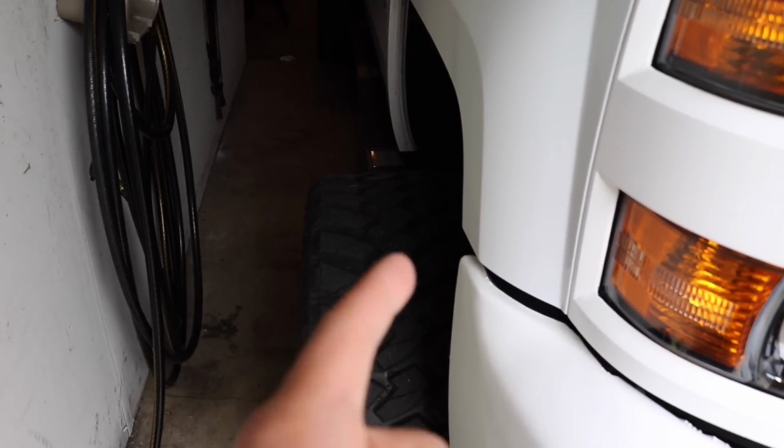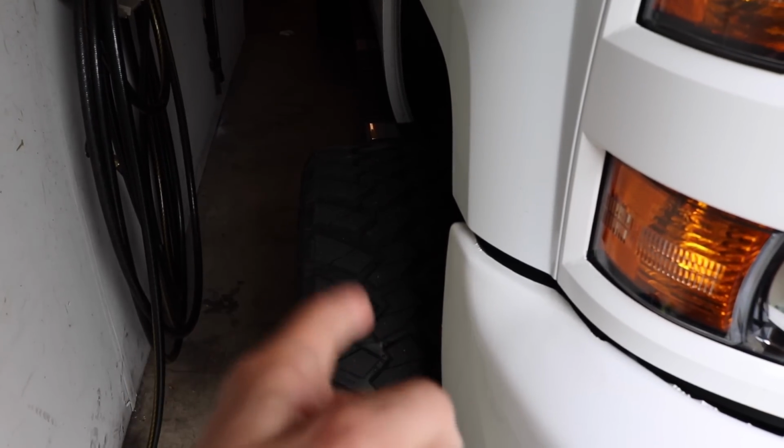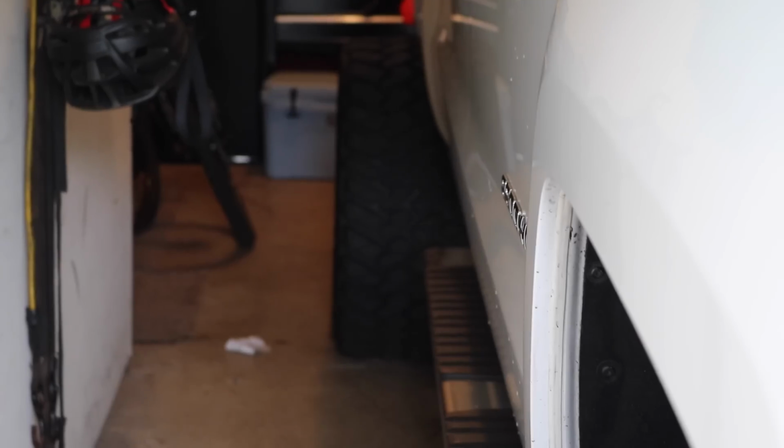So when you lift these kind of trucks, basically guys, the spindles on the new lift kit are actually thicker and will create a larger track width than the stock truck itself. That is the spindle that comes on the Cognito 4-6-inch lift. That spindle is actually thicker and wider than the stock spindle on the truck. So the result is, guys, the front wheels will actually extend more out of the truck, whether you're running wide wheels or narrow wheels, whatever the case may be, which will then result in an uneven width between the front and the rear wheels.